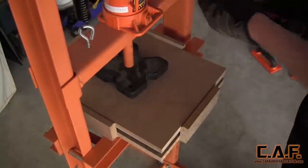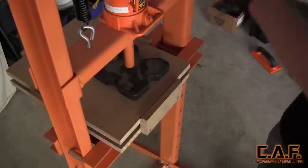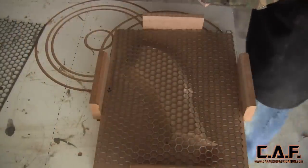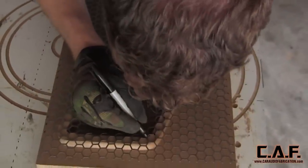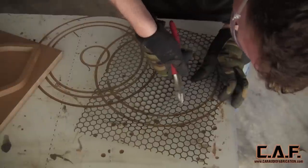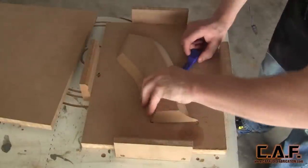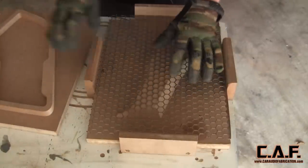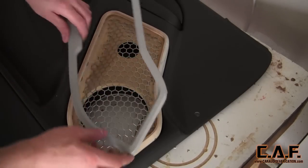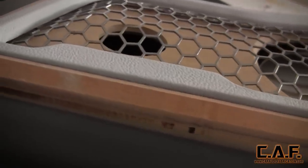Do note that with such a large piece you're likely going to have to move around multiple different times and press in different areas. With the molding process complete we can remove the top half of the mold box. I then lay the molded mesh onto the top of the mold box and transfer the lines that I need to cut. There are multiple different tools you can use to cut mesh, but for this mesh I found snips to be the best. After removing my inside shape and laying down the copy side I then repeat this process again for the mirror. And with that we can now insert our newly molded grill mesh and follow it up with the inside trim ring and marvel at our molded mesh creation.